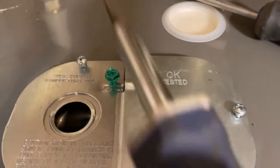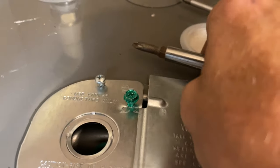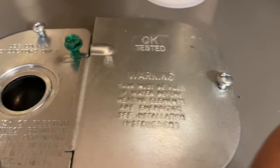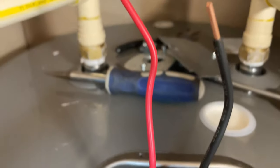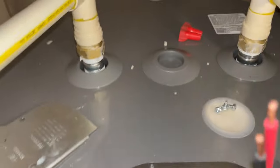Let's move to the next step. Start by removing the screws on the top panel where the power connects — usually Phillips head screws, but some water heaters have a hexagon top screw, which is why you have the six-in-one screwdriver. In this case it's Phillips head. Loosen and remove both screws, take off the panel, and here's what we're looking at: a red and a black wire.